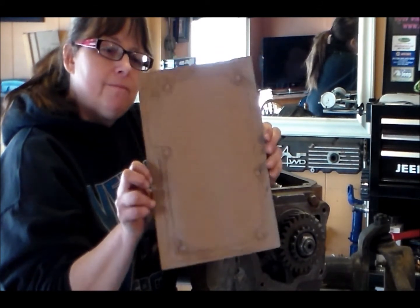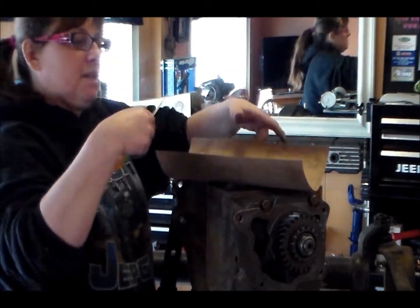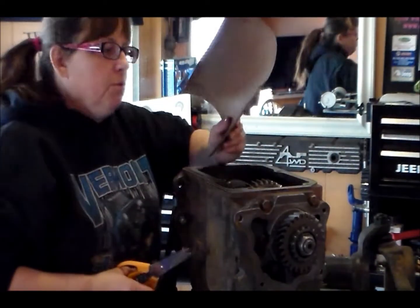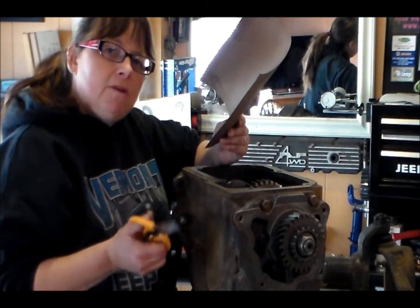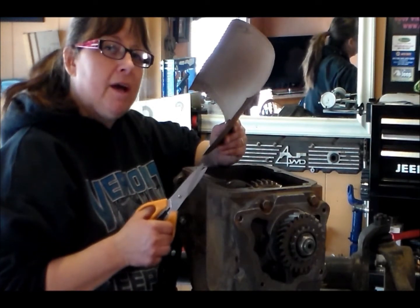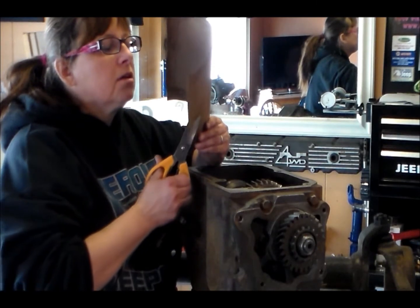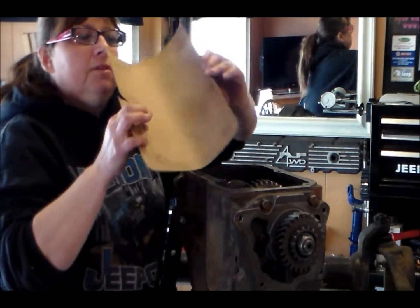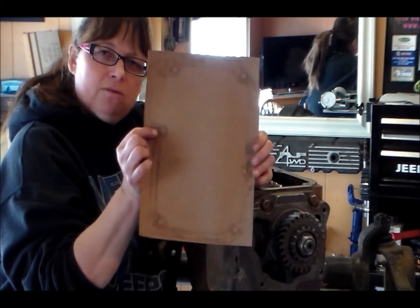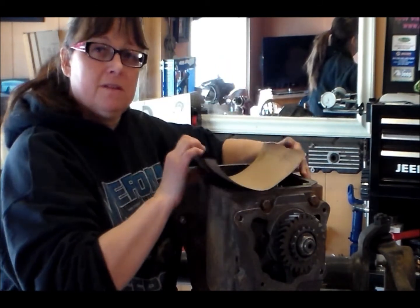What I'm going to do now is take scissors and cut this gasket out. Don't worry if you cut too far away — you can never have enough gasket material. Just don't cut too little, because you can't go back and put it back. After you're done cutting, you need to figure out a way to cut these little round circles for your bolt holes, because you can't fit the scissors in there. And I'm going to show you another little sneaky tip that's going to save your brass.